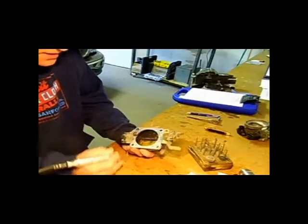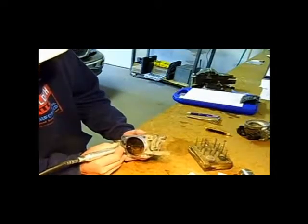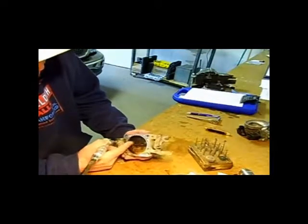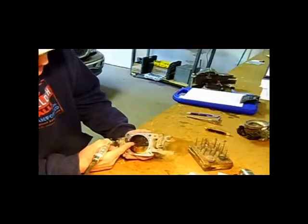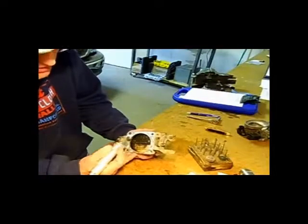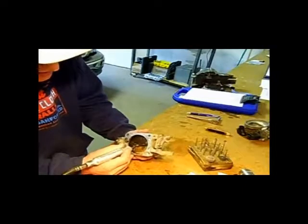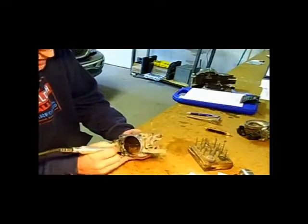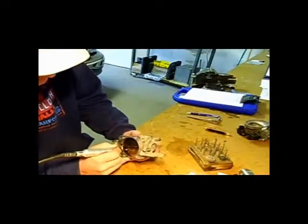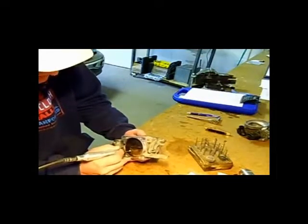Anyway, so now you're getting to the point where you're ready to cut the groove. We're going to start over here. Now, this axle is made out of case-hardened steel in almost every throttle body I've ever seen, so it lasts a good long while. But if you hit that axle with your bit while it's running, you are going to dull your bit very quickly, and it'll be worthless to you. So just stay away from that axle shaft. So I start about where I've got one bit width between the top of the bit and the axle shaft.